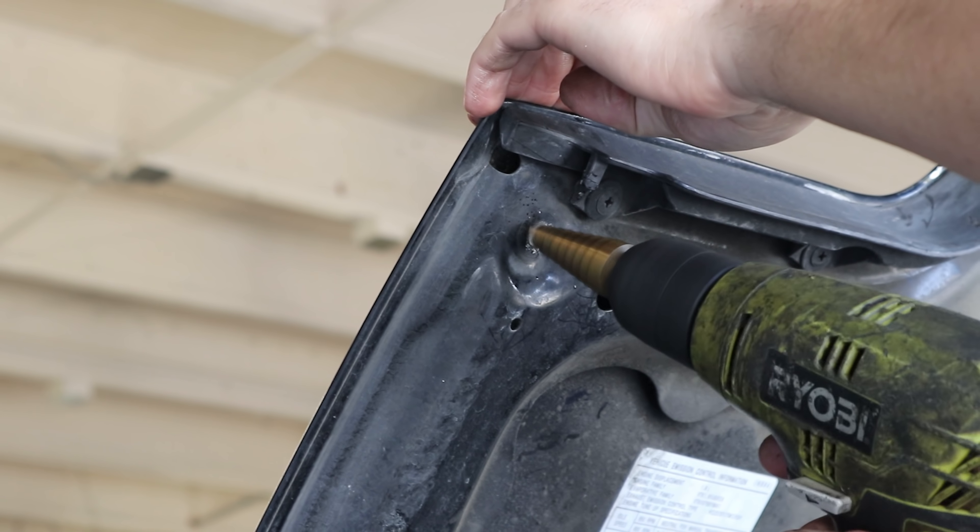Imagine that with 30s on it. The alignment is so cocked, but it's basically fully upright so it makes sense it has positive camber right now — once it squats a little the camber should be relatively nice. Now that I got the front end sitting where I want it with the new springs, there are only two more things before a test drive: new brake pads up front since the current ones are really thin, bleeding the brakes, and putting hood pins in because there's nothing holding the hood down.